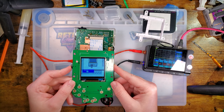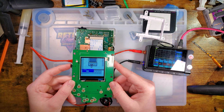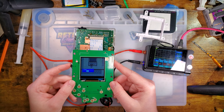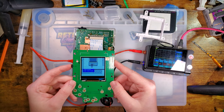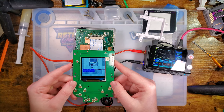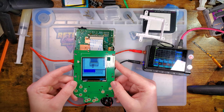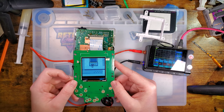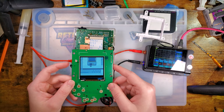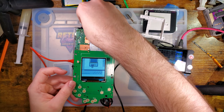We also have options to adjust the position of the display on the LCD, pixel grid options — on or off — and we have color options so we can change the color of the on-screen elements, and quick saves for all the settings. Save and exit. It does retain settings across a reboot. We've tested it, I've got my power usage numbers, so let's go ahead and continue the install.